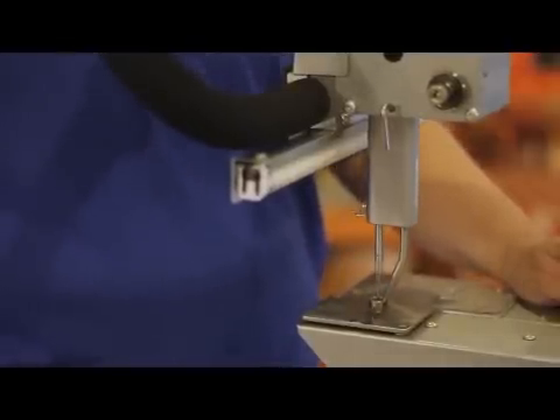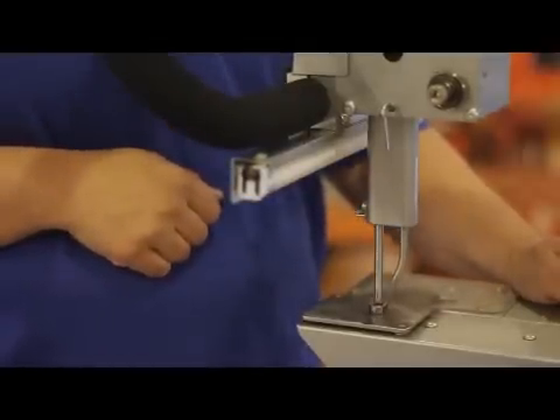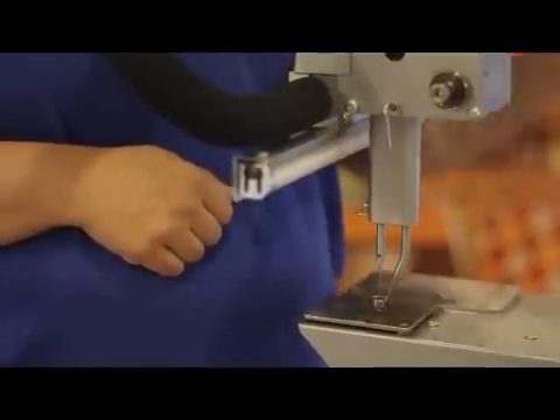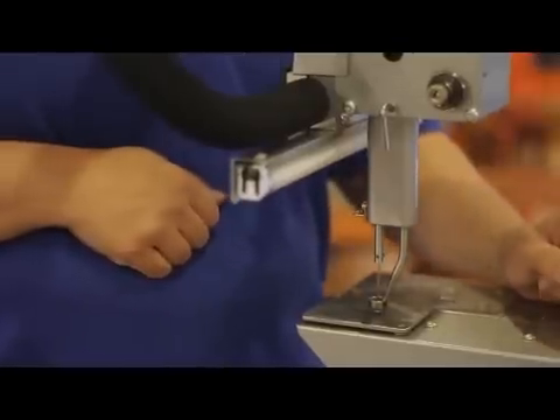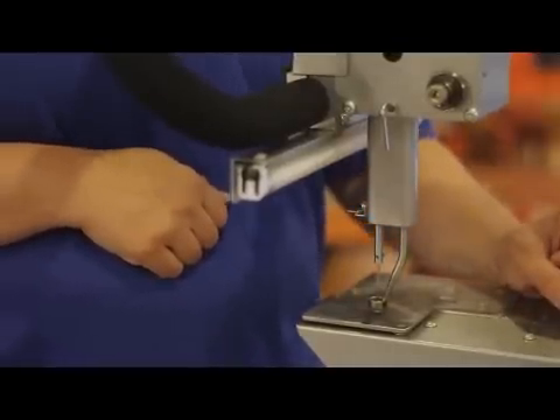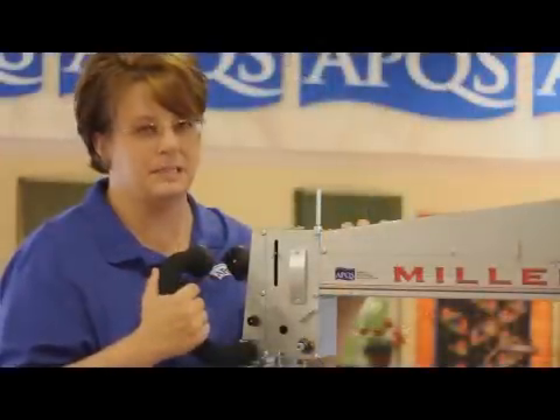It's not really sewing at full speed, but you can tell it's having a hard time finding that position. If you put a little pressure on the flywheel, that will allow the machine to catch up, and it will position correctly long enough for us to do the adjustment to the circuit board.